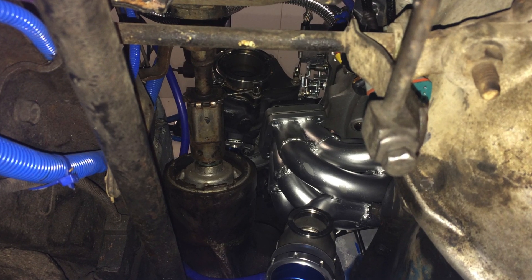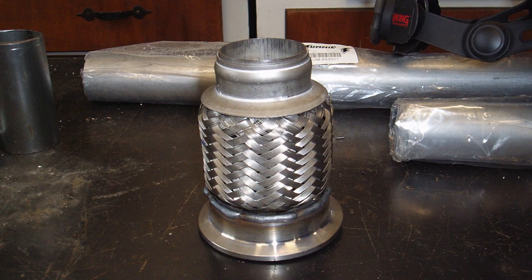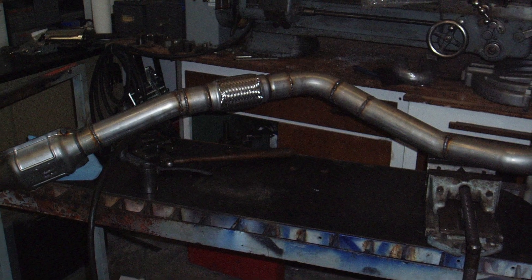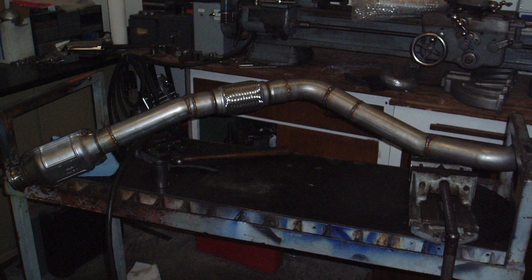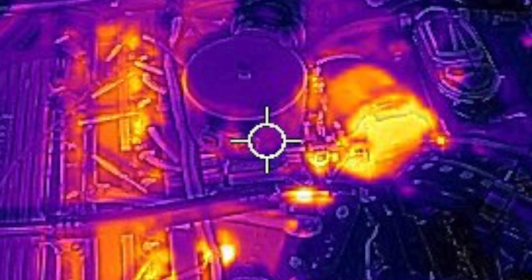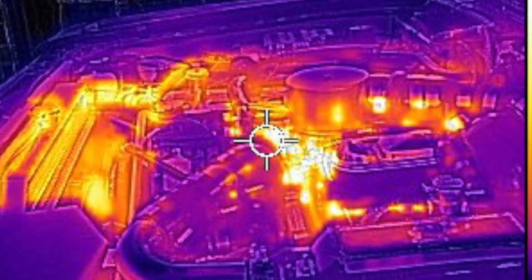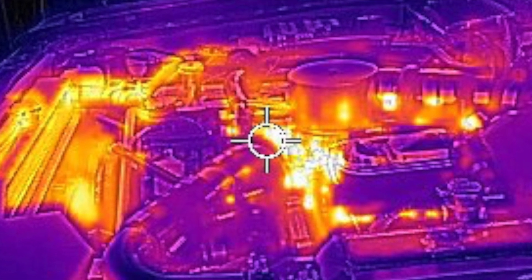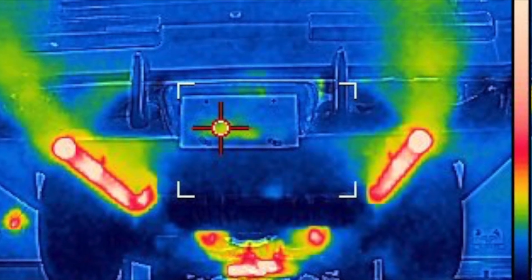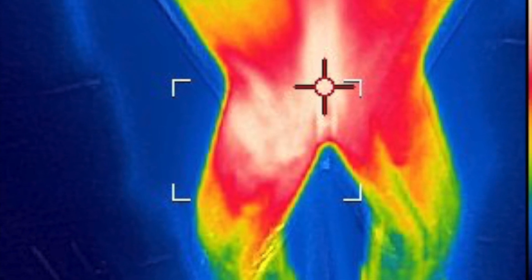This car was equipped with a dual exhaust and just Clifford headers, and with the turbo we thought let's keep the dual — that's why our wastegate is a remote one. This turbo is one of the smallest where you kind of have the option; any bigger and you're going to run a remote wastegate anyway. The turbo side of the car is sporting a two-and-a-half inch pipe, and then the wastegate is plumbed in as an inch and three-quarter dropping to the passenger side.